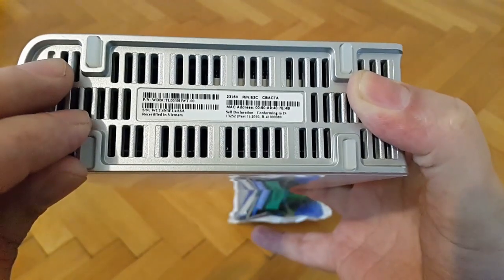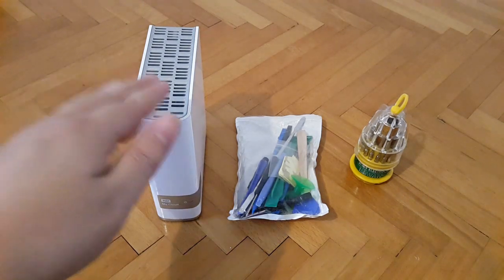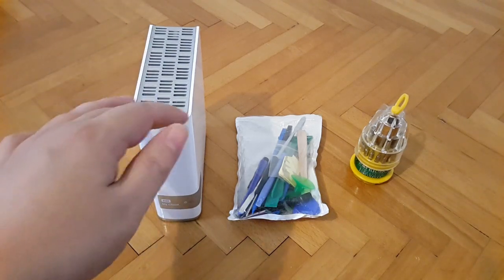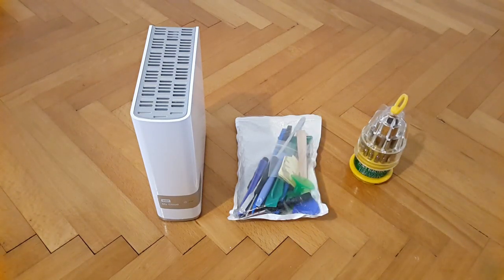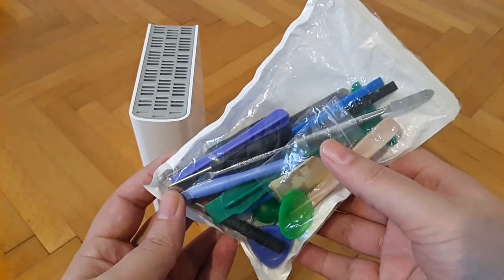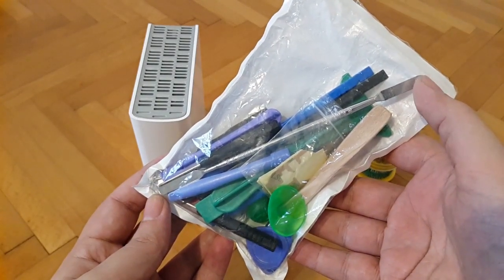To initiate the separation between the main central plastic piece of the enclosure and the front oval white mask, you'll need some sort of prying tools. You could use a dull knife or a flat-headed screwdriver, but I've been very fond of the set of prying tools I have here. I'll put a link to this and the screwdriver set in the description box below so you can get your set on eBay. For this video I'll just be needing this nickel-plated metallic prying rod.